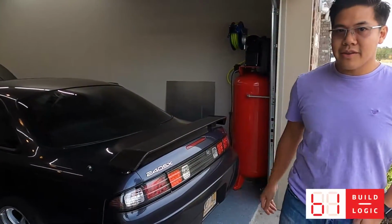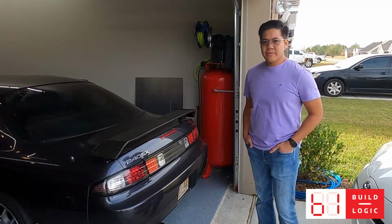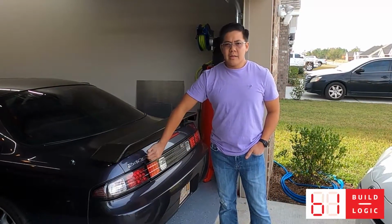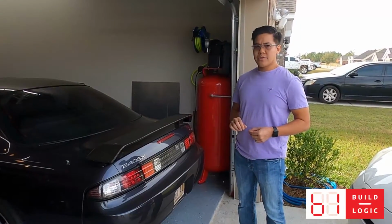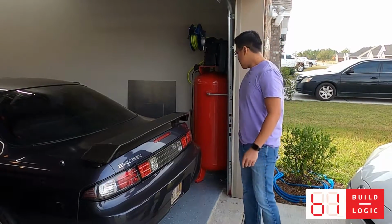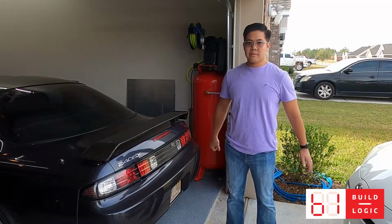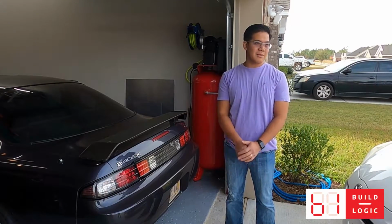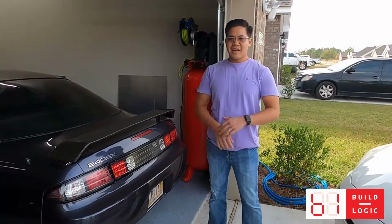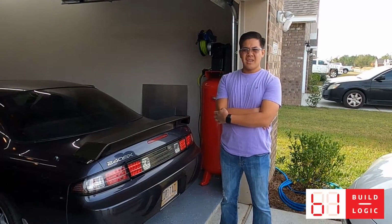Right now, as far as tuning, I've dumbed it back down a little bit because I recently switched to the 2500 ECU from the plug-in ECU, the Platinum plug-in. So I had to take the tuning down a little bit, and then I knocked it down to a 3 psi wastegate spring, but it creeps to around 8 or 9, depending on the weather, really. Just trying to tweak the tuning back in. I tune it myself, street tune for the most part, unless somebody can donate a dyno or something. Anybody got dynos? I used to do some tuning in Dallas, Texas, for Rotary Performance and stuff like that.